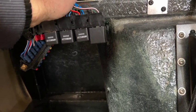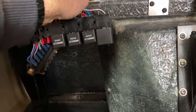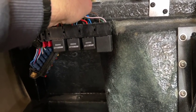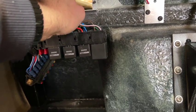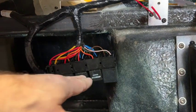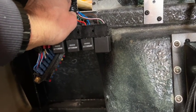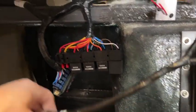Just to show I'm doing something neatly and making it more accessible, I'm going to drop the relays onto a sheet of aluminium about an inch down. You need to be careful how low you go — it was noted on my last IVA that any lower they'd want it protected with a sheet of plastic, thinking of a passenger shot forward not wanting to catch their knees on it. So I'm not dropping it too much lower. With the fuse box here, the other bank of relays goes next to it.